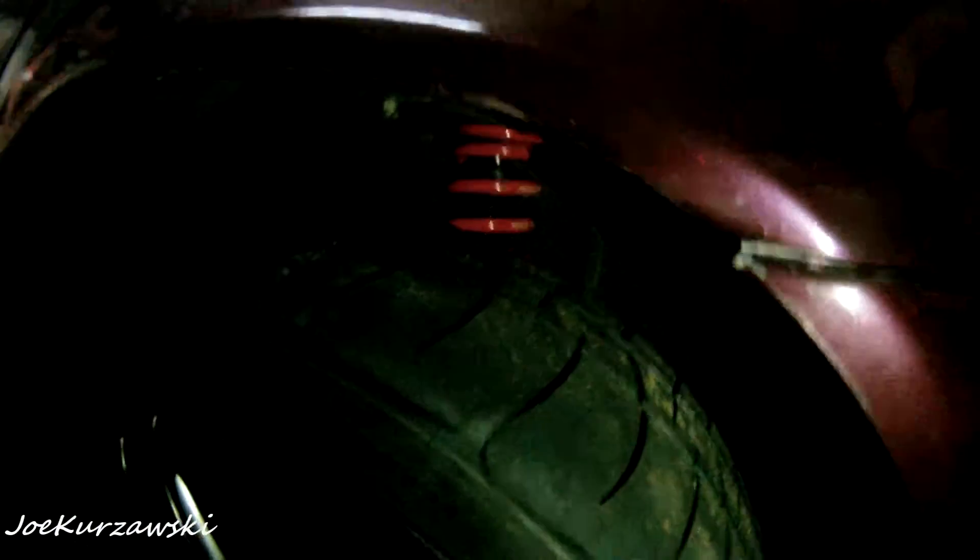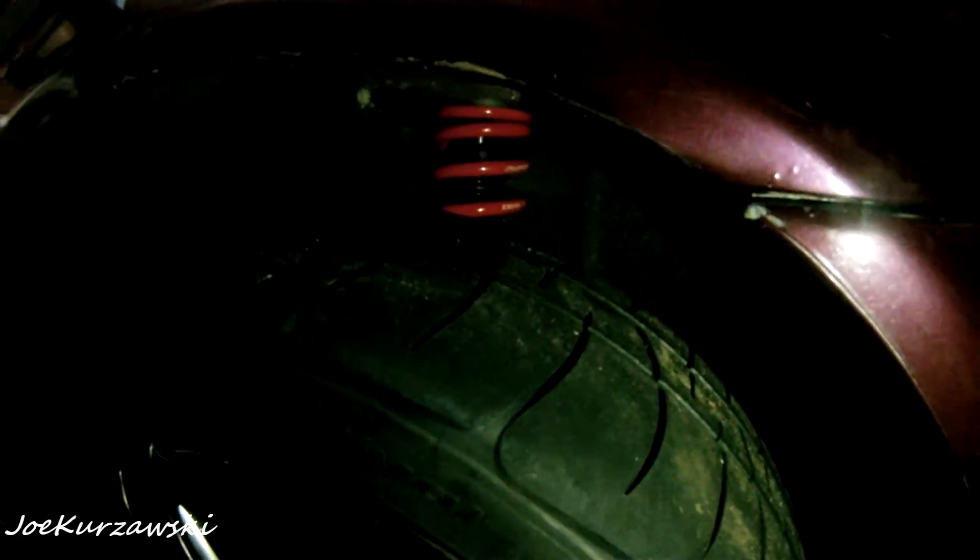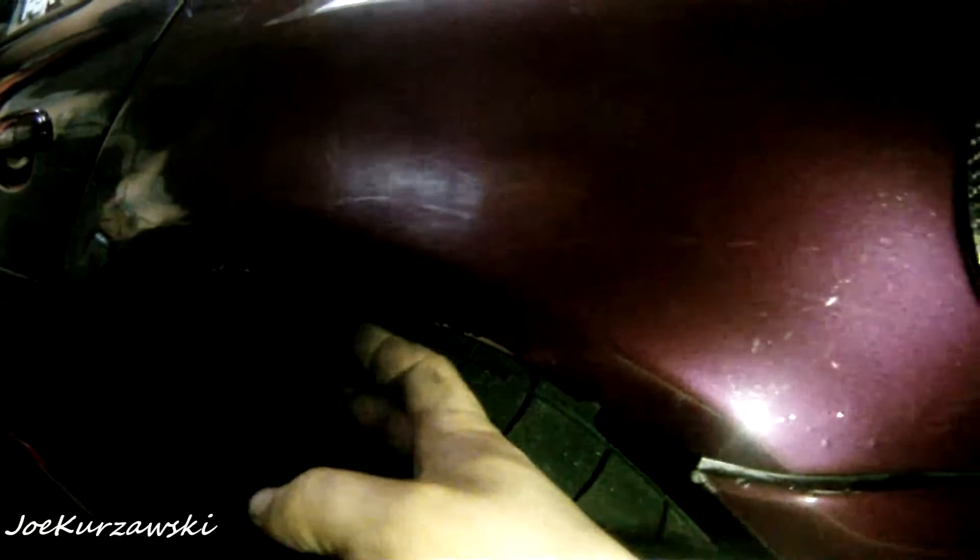So I'm going to put the wheels on and we're going to lower it down and see where the back sits so we can jack up the front. Alright, moment of truth. The rears are wound to the highest set point, so I'm going to drop it down now and see where we're at. And as you can see, we've still got a bit of gap there. We can always adjust it - I have like two inches to play with.